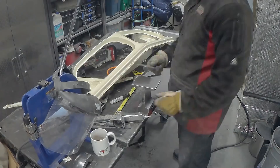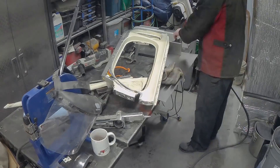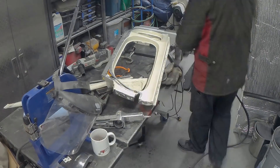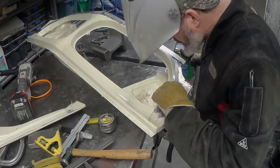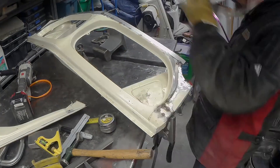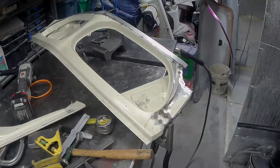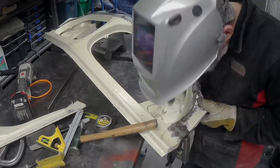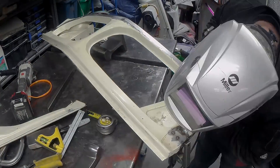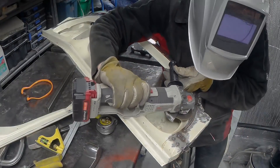A little advertising for Soup Classic Motoring — go and watch my buddy George's channel, you'll enjoy his work. It's far more advanced on the camera work than anything I could possibly pull off. So I'm now adding that 25 mil, putting in my little slivery pieces. It's almost like sheet metal showing off — these pieces get really skinny, really narrow, really tough to do. They've got a lot of shape, actually. These aren't flat panels — they're very shapely things.